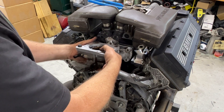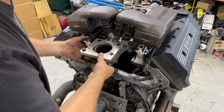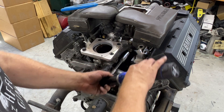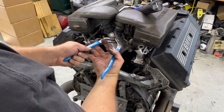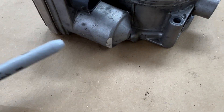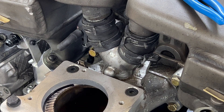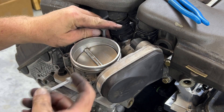Test fit the intake into the assembly, making sure to install all of the intake hoses to the intercoolers. Alignment of the clamps that hold the hoses in place will be tight, so note their alignment. Don't forget to use the factory gaskets on the supercharger-to-intake joint. If your alignment is too critical you can remove some material from the throttle body. Note that the clamp can be pretty tight up against the throttle body — push it to the back as far as you can. Install the throttle body with the original bolts included.